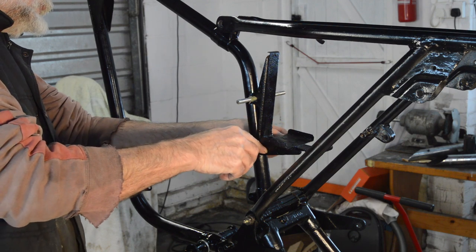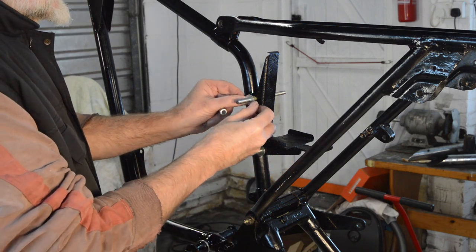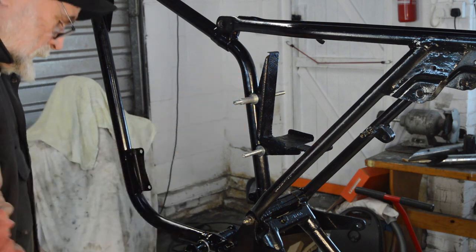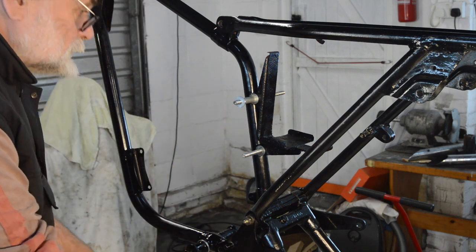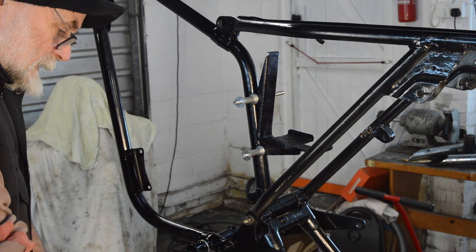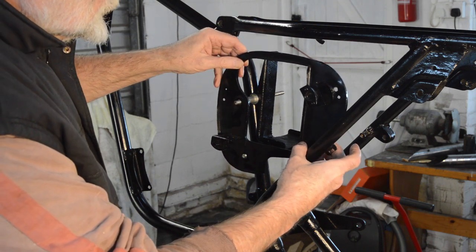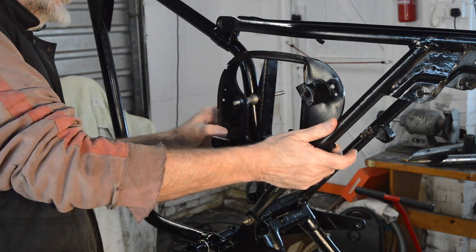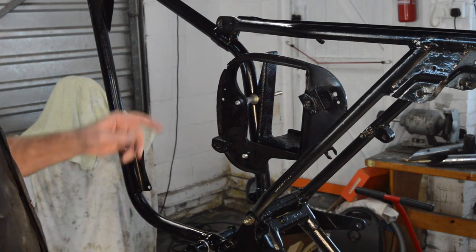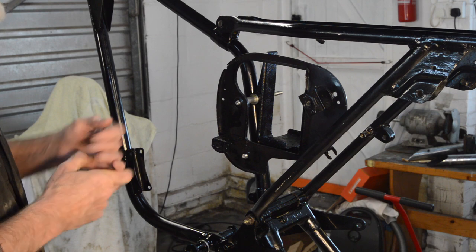Right. So I have a washer to spread the load. A spacer. Another washer. Oh, done that one. And then, in theory, the battery box should mount. Like so. Now, that's reasonably close, I think. But just in case, the reason I fitted the additional washers is if I have made a millimetre or two's error, I can move the washers about to square it up.